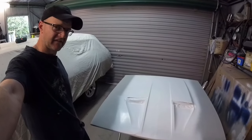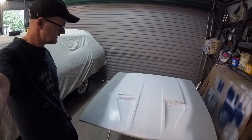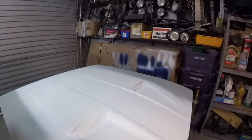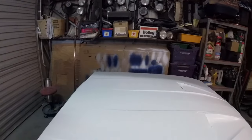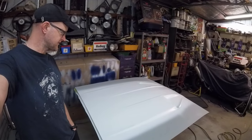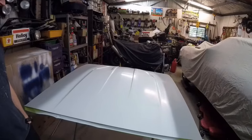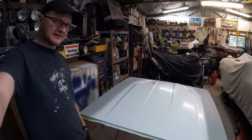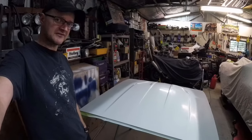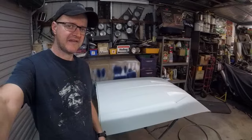It's days later and the last coat of paint that went on to this bonnet was extra thinner, and it has come up a little bit more glossy than it did initially. The plan is to clear coat this bonnet once the blue goes on, so it'll have a gloss finish for a single pack acrylic — that'll do. It's time to get into the masking so I can throw down some of this leftover blue paint.